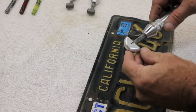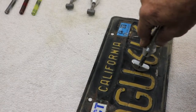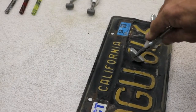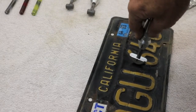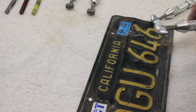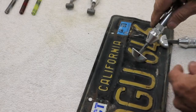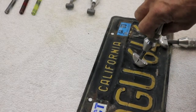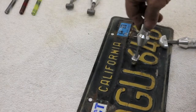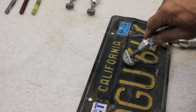Utilizing our half-round on our hex shaft and applying pressure, we can actually remove the dents. The spring pressure is what's removing the dents. If we try to utilize the round shaft, it doesn't allow us to actually stay in a fixed position — it just wants to move around and we cannot really operate this tool efficiently.